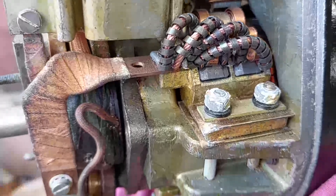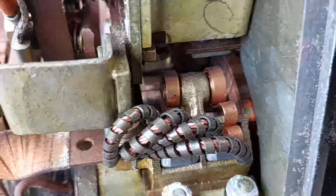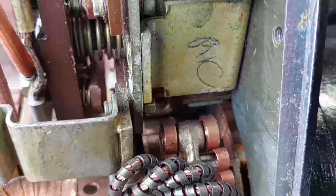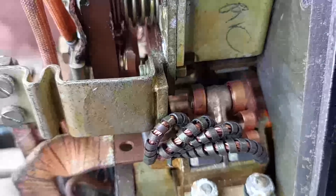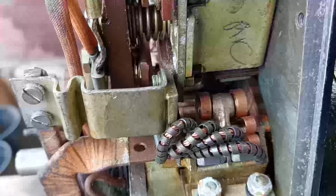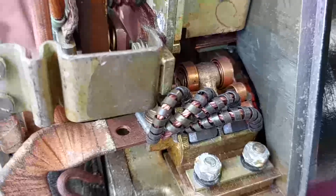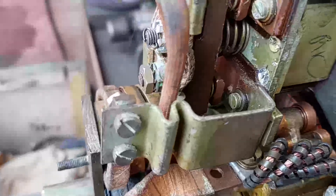The innards really are beautiful — isn't it gorgeous? Look down there if you can see — do you see the commutator? Lovely commutator. And that does not move forward as described. So the commutator is stationary and the brushes are simply sitting on there, not having to slide at all. Large double sets of brushes — you can see them there as on the CAV. There are four sets of brushes in total on this starter. This starter, by the way, is a 12 volt starter.